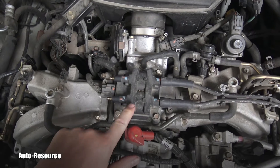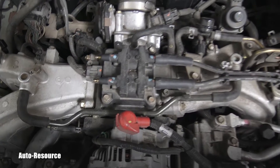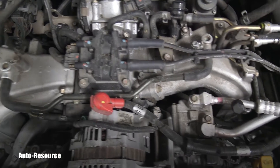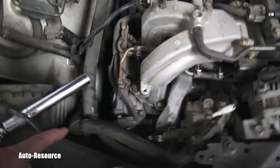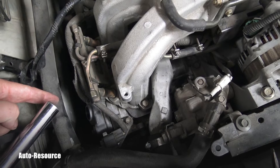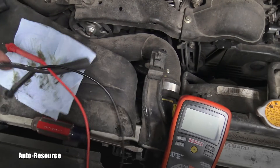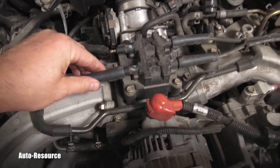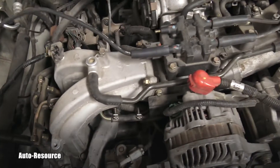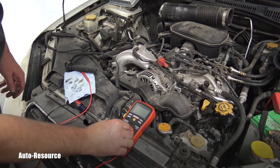Look, they are nicely and evenly marked here — you don't need to remember it — one, two, three, and four cables to the cylinders. So obviously there are these cables coming from the coil to the cylinders. Number one cylinder is this one, so I pulled that cord, disconnected it right here — it is connected from there — and pulled it from down there from the spark plug.